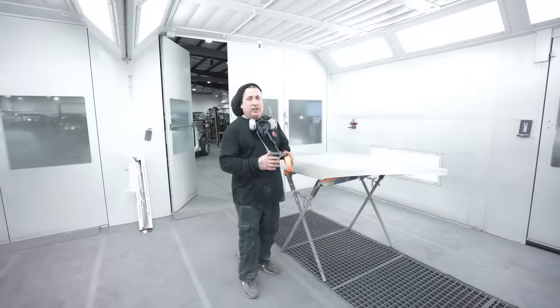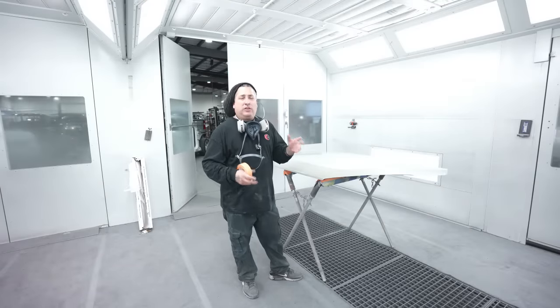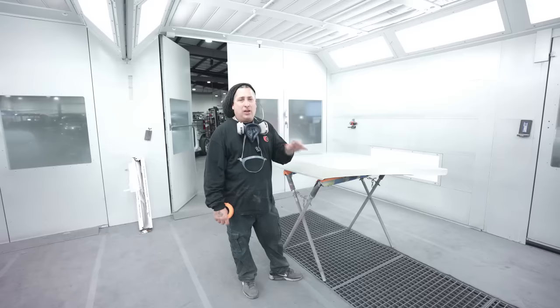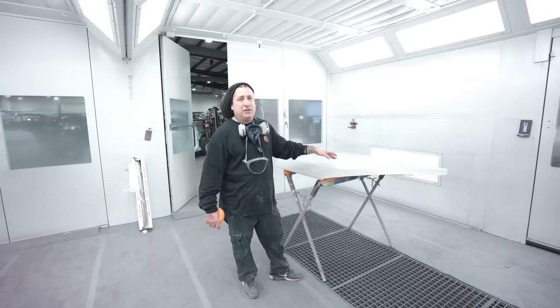So what we're gonna do is hit it with our etch wipes. Once you get it clean, they want you to use their etch wipes, and that etch wipe has to wet up the metal that it's going on. Make sure that those are actually new, they're not outdated, and they're not dried up in that container, because they want that metal to stay wet for 1 minute. That way they know that it has the true etch on it. So these are etched from the factory and then they're dipped in the E-coat. That's why we have a lot of mils on this part.